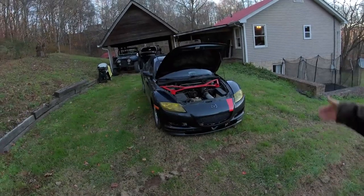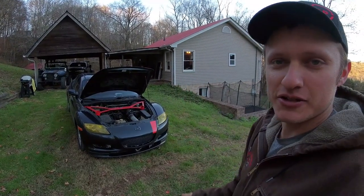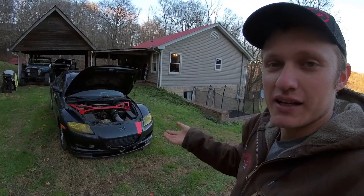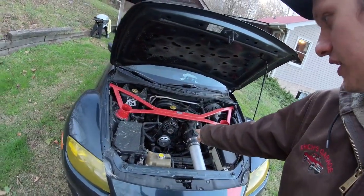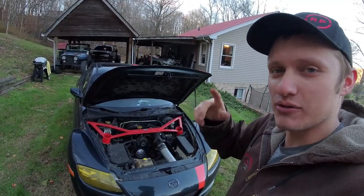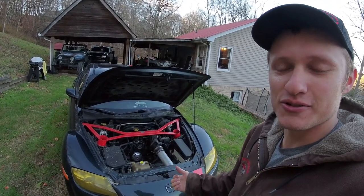So, first things first, right off the rip, maintain this chassis just like you would maintain any other normal car. The transmission, the diff, the suspension, none of that stuff is rotary specific. So if you know how to maintain a car, then you can maintain 95.9% of an RX-8. The only thing that's different is that little tiny engine down there in the bottom, right? This is a 1.3-liter rotary engine, the spinning Doritos, it's got little triangles in it. They spin around really fast, and there are no valves inside this engine, hence the two-stroke dirt bike, two-stroke chainsaw reference.